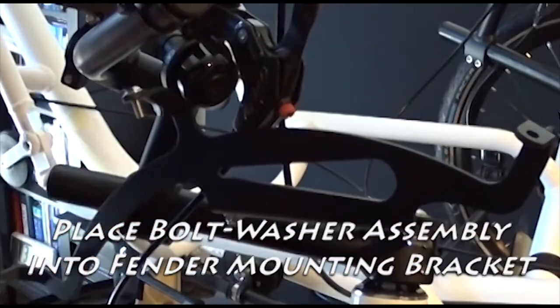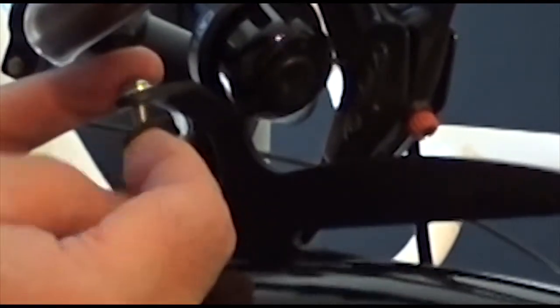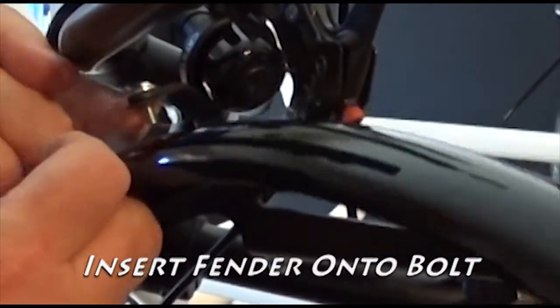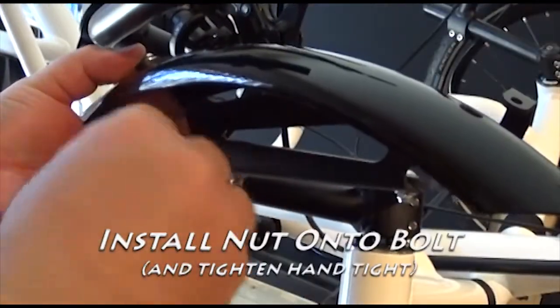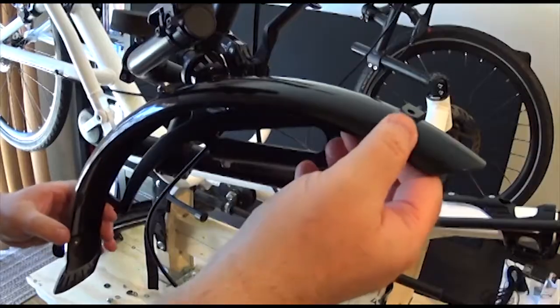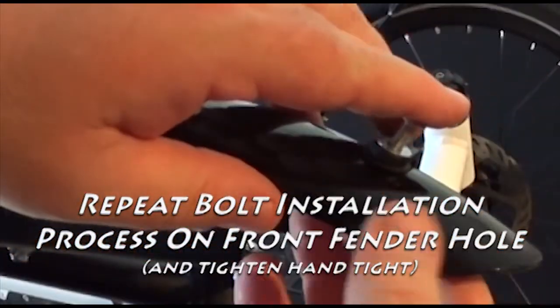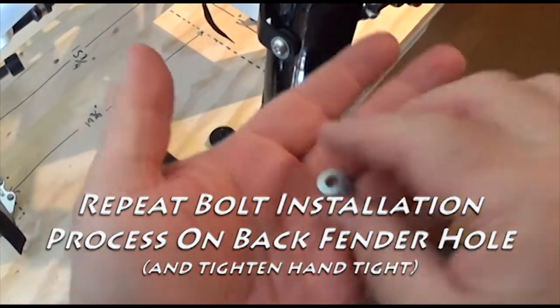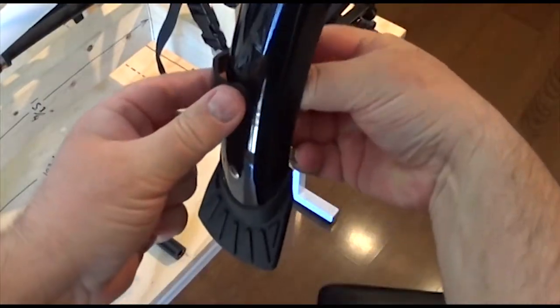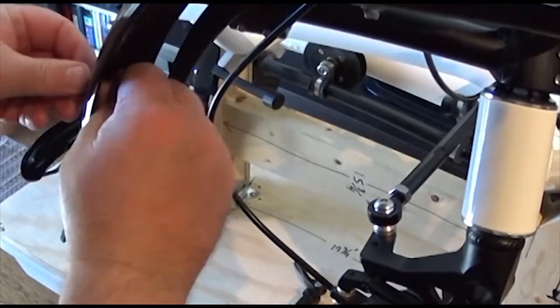To install the fenders onto the mounting bracket, insert the bolt and metal washer onto the fender bracket, then insert the rubber washer onto the bolt assembly. Next place the fender into the bolt assembly, then place a washer on the end of the bolt, then a nut. Tighten this nut hand tight — pretty much go as far as the nylock will let you. Next install the bolt assembly on the front of the fender; don't forget to put that little rubber washer in — that's very important. Once you have that front bolt assembly hand tight, install the bolt and nut assembly on the back of the fender. Make sure you get that rubber washer in there, and there's also a little metal washer on the inside. Tighten up that nut until it can't be tightened anymore.